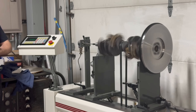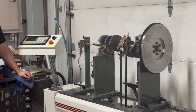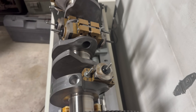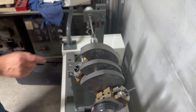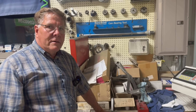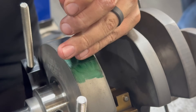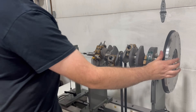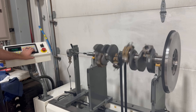At 770 RPM — crazy to think that's just idle speed. Reading 4.6 on the left and 3.2 on the right. The 3.2 wants to come off right on the edge of that counterweight at about 11.5 degrees — right in line at the top. We're really close — honestly for a bone stock motor this would probably be good, but let's get it closer. We've now got three holes in the crank; hopefully that's all we'll need — maybe a little touch-up grinding but no new holes.